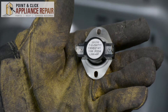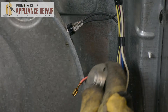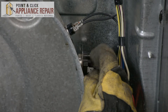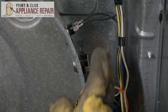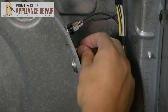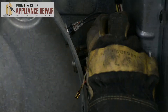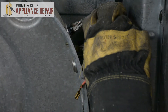Now you can grab your new OEM replacement thermostat. If you don't have one already, you can find it on our online store. Now I'll put the thermostat back into place — slide the tab right into the slot, and the round piece fits nicely into that round hole. Everything should line up so the top is aligned with the screw hole. Now I can screw it back in — I'll start the screw by hand and then finish tightening it with the stubby screwdriver.